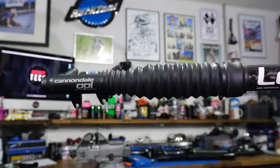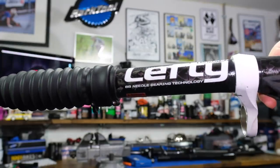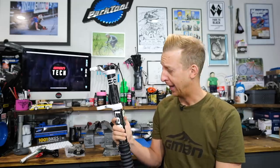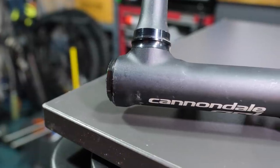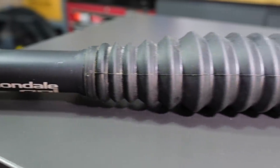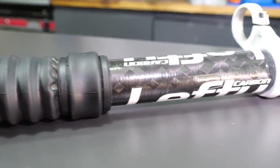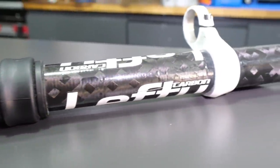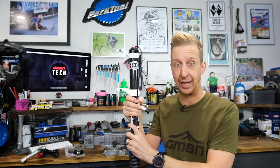Skip to the year 2000 and the release of the Cannondale Lefty Fork — the single-leg suspension fork that still defies physics just looking at it. Half a fork, after all. Cannondale were trying to make an inverted suspension fork with the stanchion at the bottom instead of the top. The idea is your seals and everything are better lubricated — held there by gravity rather than relying on capillary action of the lube staying between the bushings. On motorbikes you always see forks this way, but it's hard to make them stiff and light enough on a mountain bike.